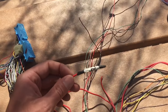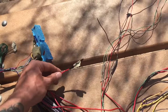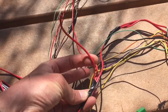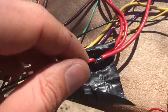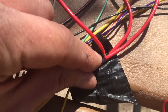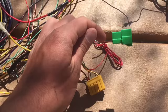In a van this could connect to the battery lug in the black box, but we're going to leave it near a fuse. I'm going to peel back the Subaru taped section and cut off this dead lead for battery positive. This is the Subaru crimp connection — I peel it back, cut it off at the bare copper, then re-tape it. And there we have it, back to how Subaru had originally created it.